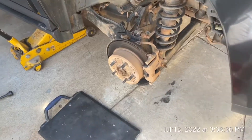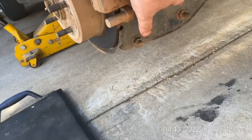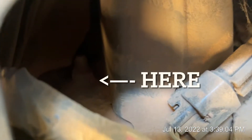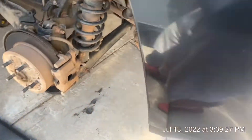I got the other front strut in. Now it's time for the rear struts. I'm going to take these two loose. Thank god they didn't leave a spare tire — it would have been hard to get to this. I had to remove the spare tire area access. You can see that bolt there and that bolt there — take those out, then pull this big piece of insulation out of this hole and you can reach the bolts inside.